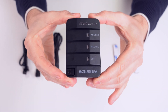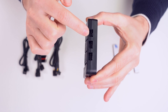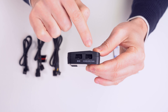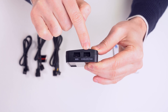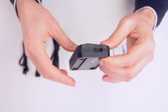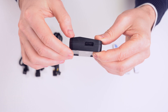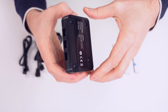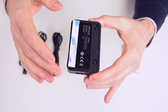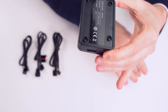Cooler Genie is a system fan controller. It can control up to three case fans which can be connected by three connectors — all of them are four-pin, meaning they support PWM. On top there are two ports: one for the CPU fan and one that can be connected to the motherboard for PWM control. At the bottom there is a proprietary connector which connects to the power supply itself and delivers power to this fan controller. On the other side there are two spaces for stickers — you can choose between a velcro version or a magnetic one, depending on how you want to attach it.